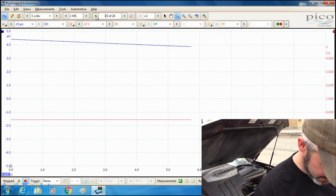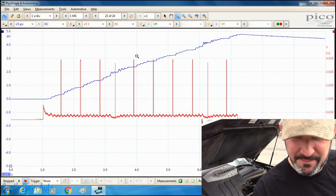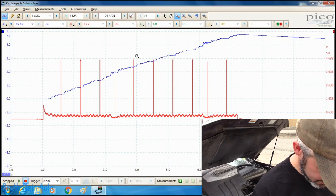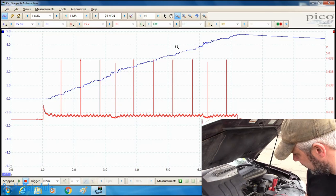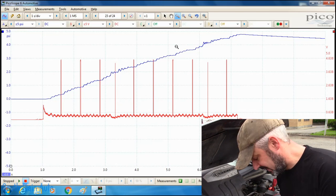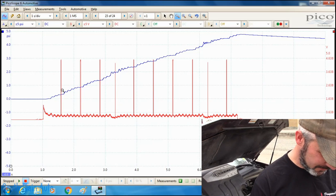Let me pause this and back up a page. Nothing definitive — I was hoping for some definitive humps but that is just a continual build of pretty insane pressure. Five pounds of pressure in the radiator just cranking it over. I guess it confirms my hunch — the engine or the head gaskets are nuked.